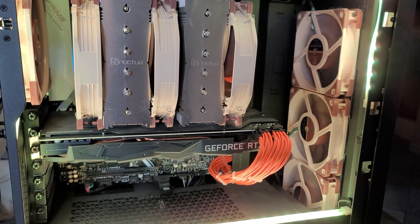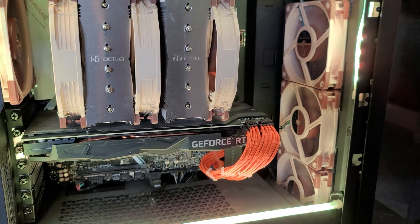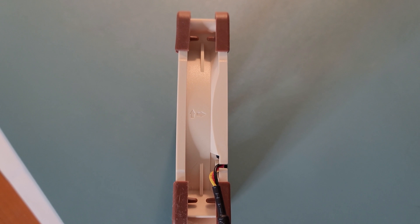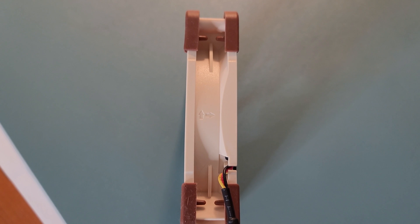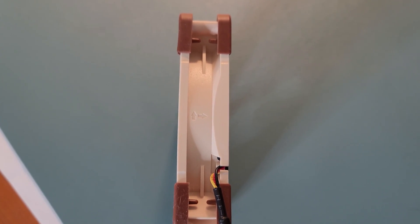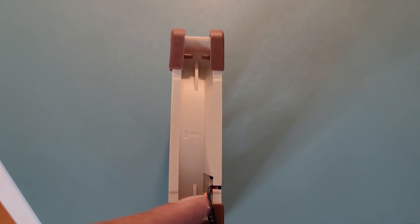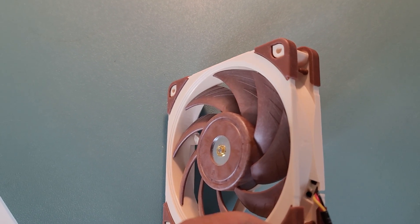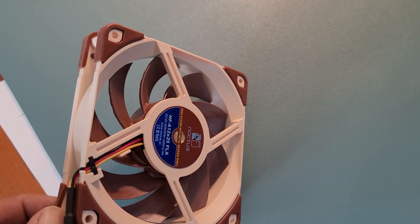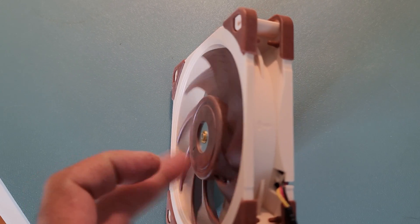Now if you're a beginner, you might be asking: how do I orientate these fans? Which way is intake, which way is exhaust? Well let's have a look at one fan. On just about every fan, like Noctua fans, you'll see two arrows. You can see one that's pointing up and then a horizontal one pointing to the right. The horizontal arrow is the airflow direction — so that's the front of the fan and that's the exhaust side. The arrow pointing up shows the direction the fan blade spins.